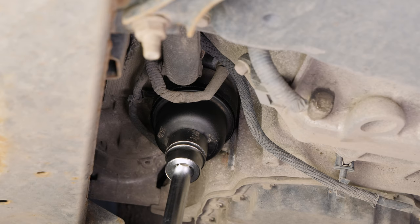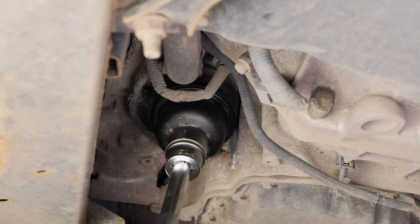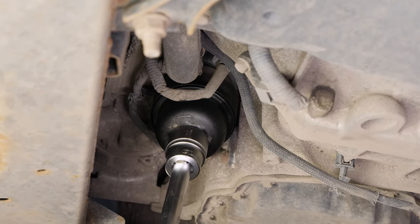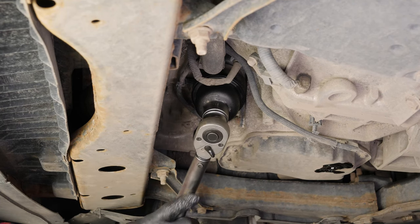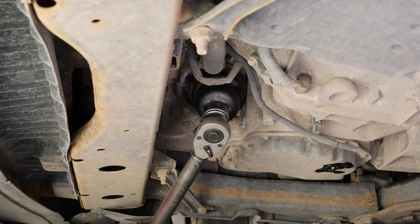Be careful with this kind of filter — the new joints can be excessively thick, making the actual tightening process more complicated. As a result, you have to ensure that the flange washer is flat against the metal engine frame. For this step, you can also use a torque wrench set to 25Nm.